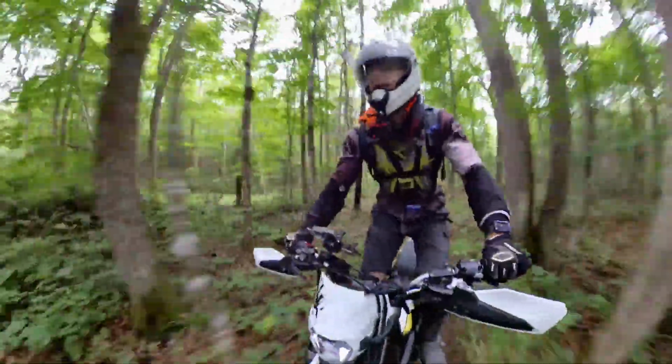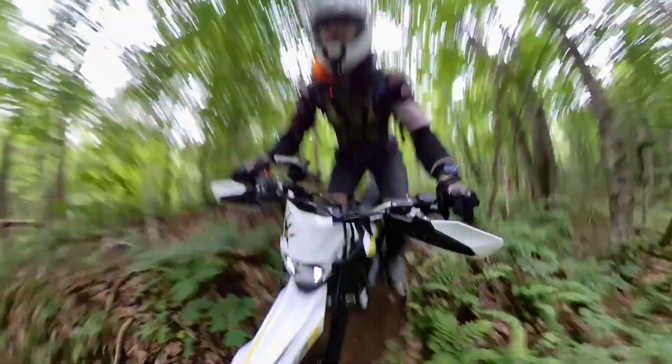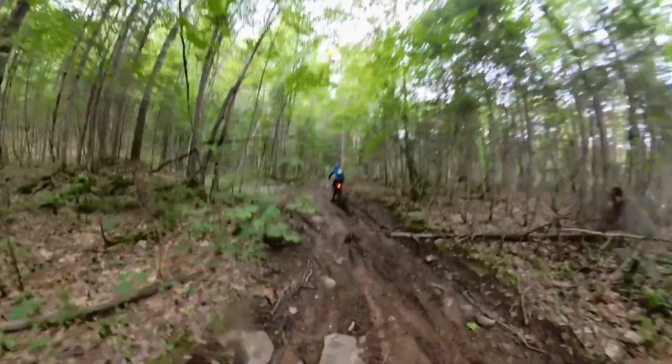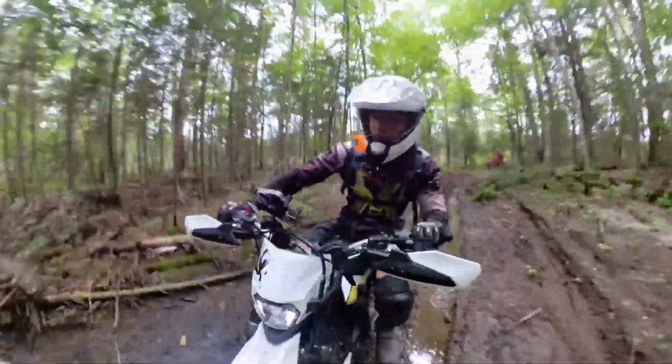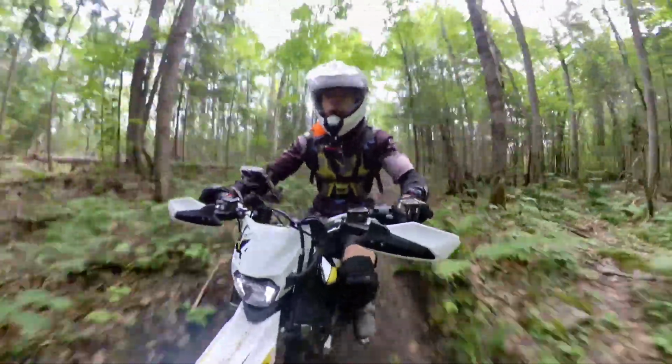Finally, seating position is your typical dirt bike fare. At 6 feet tall, I found it natural and comfortable with plenty of legroom. The bars are a bit too low for me in the standing position, so either risers or a taller handlebar might be in my future. Other than new wheels, extra battery, and new handlebar, the only other thing I'd replace are the stock handguards. I'll throw on some bark busters to protect my levers.